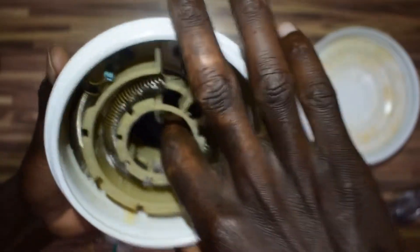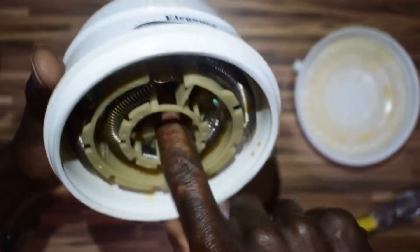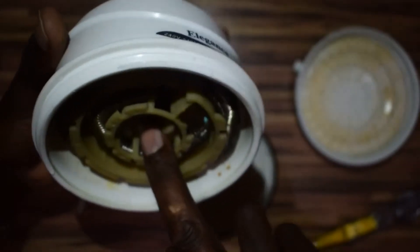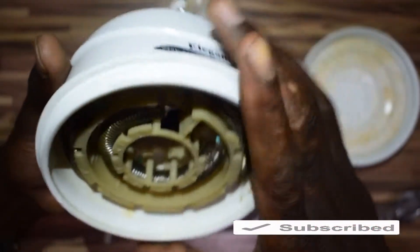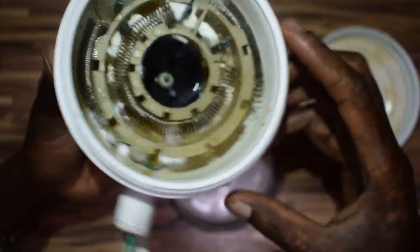Then there is the black one in there — you see it? I'm pressing it. It's called a diaphragm, and this is the one that operates the switch here that completes the circuit. It's pushed by water — when water accumulates in here, because you've opened your tap and water keeps coming in, it enters and pushes the switch up because it is soft enough to be pushed. That operates the switch and then you have hot water. That's it! Thank you very much for watching, see you next time.